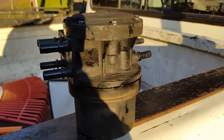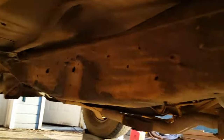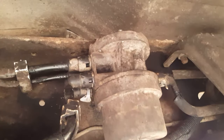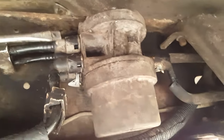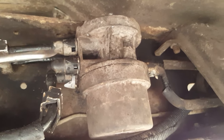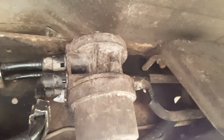So let's take a look at exactly where it is on the truck. Go to the driver's side, right underneath the door — there's a frame rail and it's right underneath here. It's actually pretty simple to get to. All you have to do is get a flathead screwdriver, pop these clips off. They're probably gonna break because they're super brittle, and then these just slide straight out. You can get your screwdriver in and kind of pry them back, twist and push them out that way.